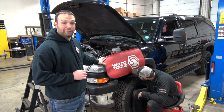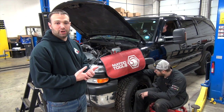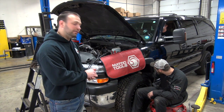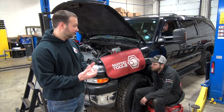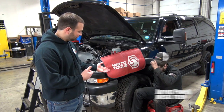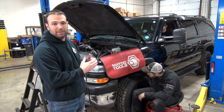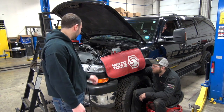All I can tell you right now is we are definitely testing new parts. So a compression test — really what it says is how much compression is the engine making just cranking over. We take the glow plugs out of the engine, put the fitting into the glow plug hole, and hook up a pressure gauge. We get good amperage on the battery, crank the truck over at least six times. After six revolutions, Jared's going to look at his gauge and see the needle come up — wherever that needle lands is our compression number. It should be in the mid-300s, with no more than 50 PSI spread across the board per GM spec.